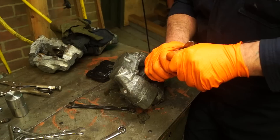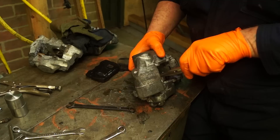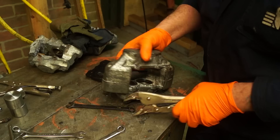I always find that depending on the angle you get with the mole grip, you have to adjust it to get the right grip on. Turning and levering at the same time and they come out. The harder they are stuck in there the worse they can be, and it's usually a dry seal that will stop it from moving. Use brake fluid as a lubricant - don't use WD-40, because WD-40 is a mineral oil and it doesn't mix well with brake fluid.